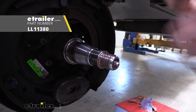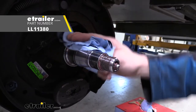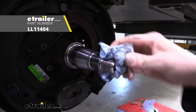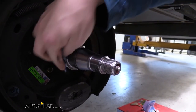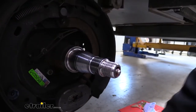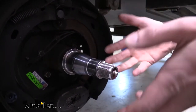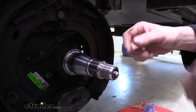This is just the common red wheel bearing grease that you see, which we do sell here. We are going to be upgrading it with a marine grease to ensure that no moisture can get in here and cause any issues. In most cases, you don't need the marine grease, but depending on where you use your motorhome — if you're in areas where you're going to be down in the water — it's going to be better for it. We noticed this customer is from the north where there's a lot of snow, so there's potential for meltage and a lot of moisture. So just to be on the safe side, we're going to use that.